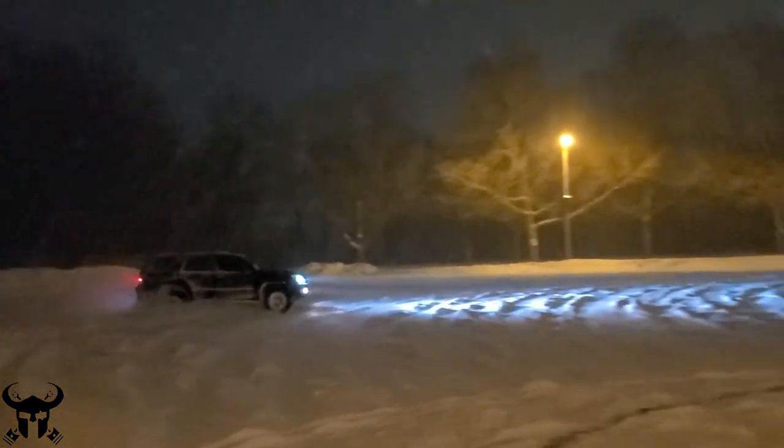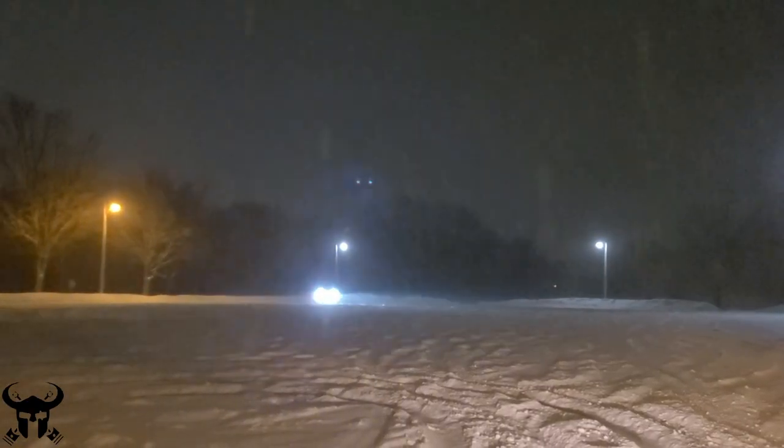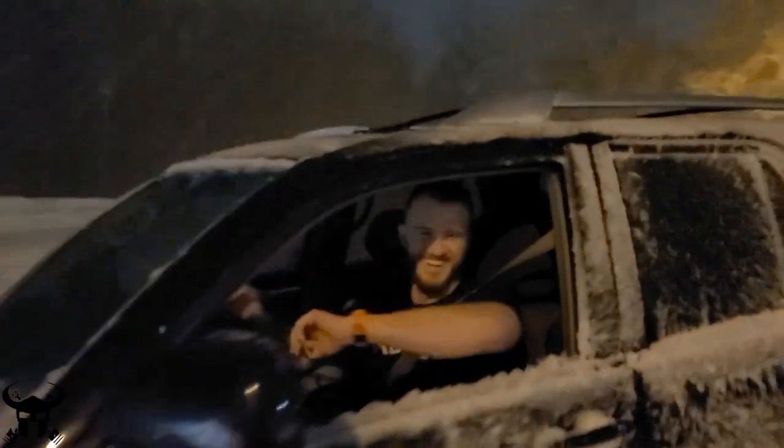I've been doing a little bit of drifting. That video was taken in Tijuana — I drove down there with the 4Runner. Who knew they got that much snow in Mexico? After three tanks of gas through the 4Runner drifting, that steering column shaft became pretty bad. The U-joint was sticking and binding, and I was lubricating it with T9 lubricant, but the duration between lubrications started shortening, and that's why I decided to change the U-joint out.